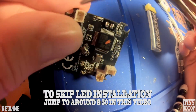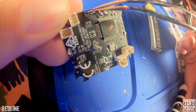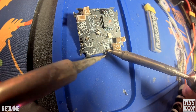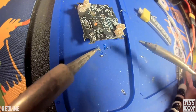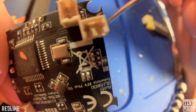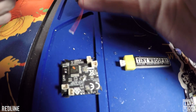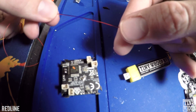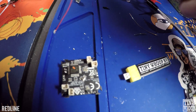Next thing we're going to do is get these little LEDs off — there's four of them on here. There's two little pads on there that we're going to have to use a soldering iron to get them off. The best way is to use two soldering irons so you get heat on both sides and they just pop right out. There's going to be a pointer to the negative pad — so negative, positive — same with the other four. You can see there's the negative and there's the positive. With the LEDs, you get four, pick your favorite colors — I've got some blue ones here. To know how much wire you need to cut, since it comes with a ton of wire, I just put it along my pinky — about three inches or so — and then cut it off. That usually gives you enough room to move wherever you need to along the ducts.